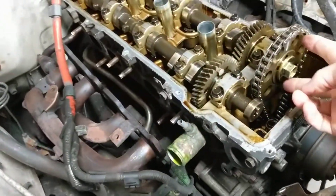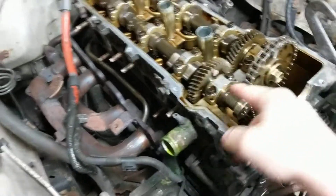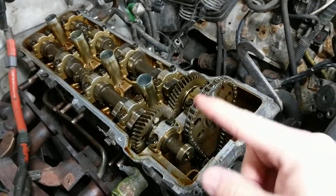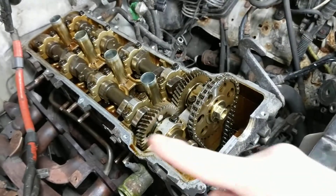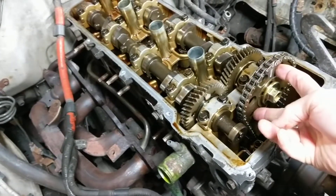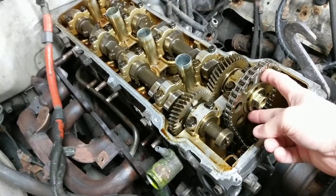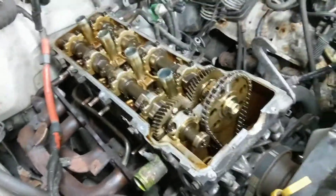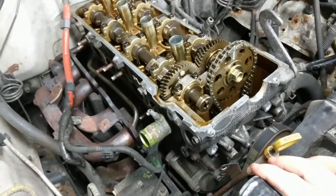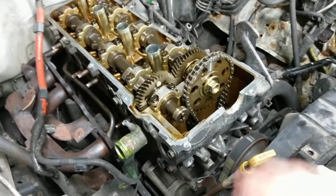The next thing I've seen — which was a great tip — is that someone made a specialized tool out of a long piece of steel bar and a shorter piece with two bolts that fit into the gear and braced against the fender to keep it from moving. That's a good idea, but you need a long bar, the bar can bend, and it's still kind of fussy.